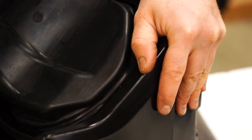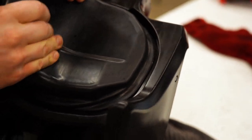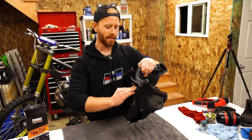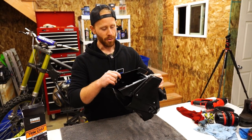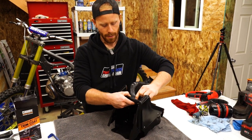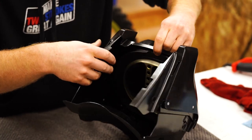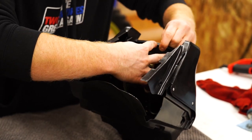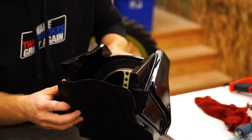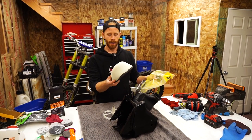I'm using a little plastic trim tool from the inside of the airbox and just pushing that boot through to the outside — seems to be working pretty good. It almost seems wrong not putting sealant on this boot, but the design of this Suzuki airbox is really good. You don't need to put any sealant there — if dirt gets through right here, it still has to go underneath into the airbox right through here, and you still have the filter that seals right to this flange. So there's really no way that dirt or anything could get in there.